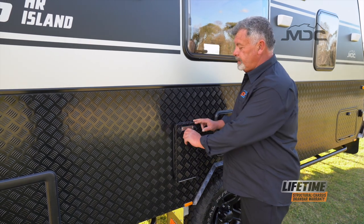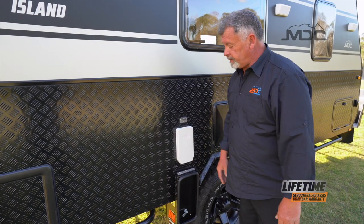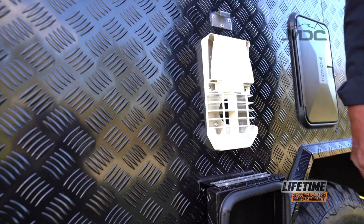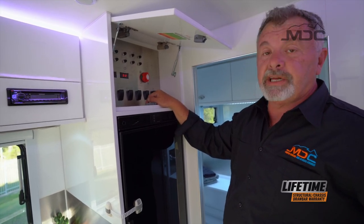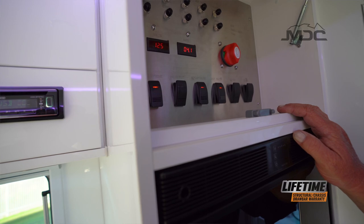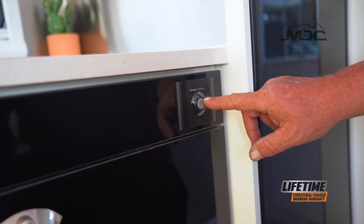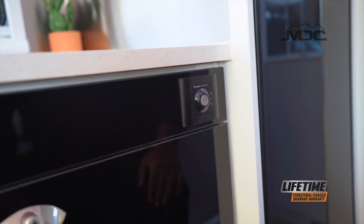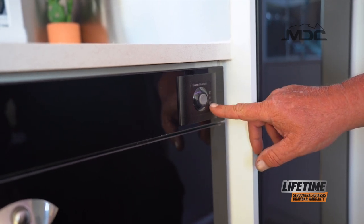Before you engage the hot water system, come around to the side of your caravan and take off the flue cover. Open the big panel, remove the cover — that clears the vent and allows hot air to escape from the hot water system. Now switch it on inside: first put on the water pump, then the hot water switch. With everything switched on, gas connected and water on, simply push the button to activate. The centre position is off. To select the temperature, up is for 60 degrees and down is for 70.